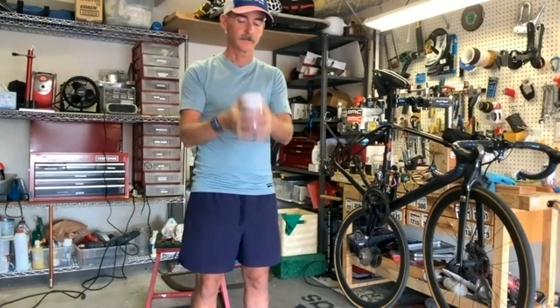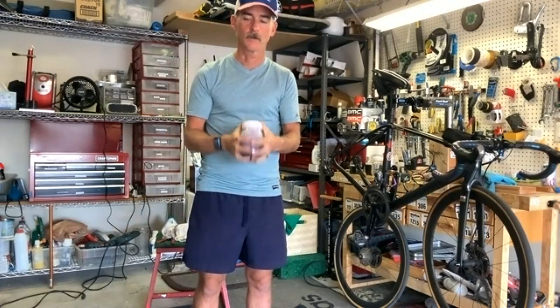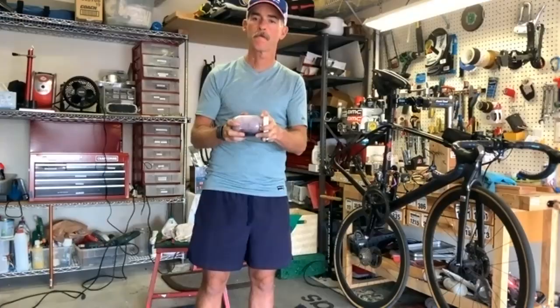Actually, we should talk a little bit about the different lubes, John. What kind of lube do you use? I should have gone and grabbed it, but I think it's a White Lightning lube that I use. But if I'm just trying to do a quick maintenance of my chain, I'll take a lube cleaner and wipe it down while on the bike, and then I'll add some lube specifically to it, going link by link with the lube.